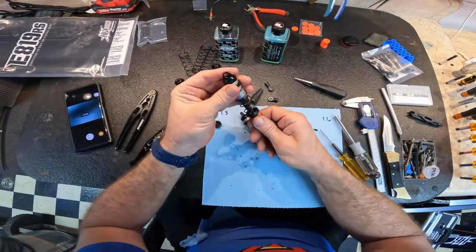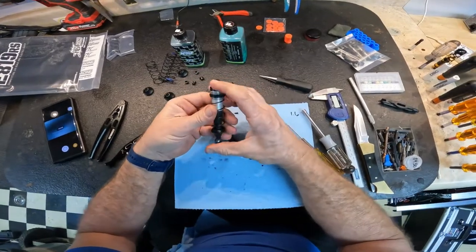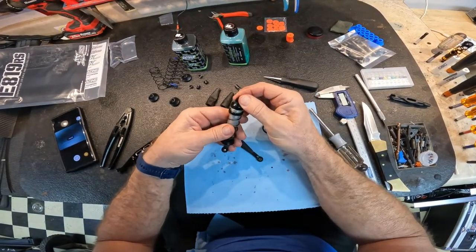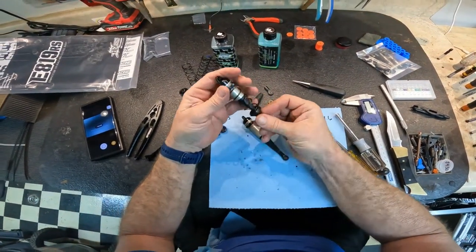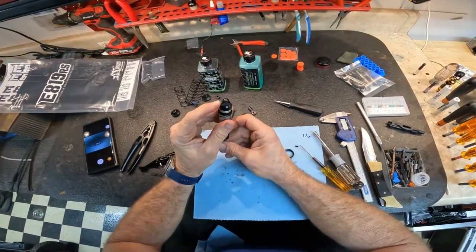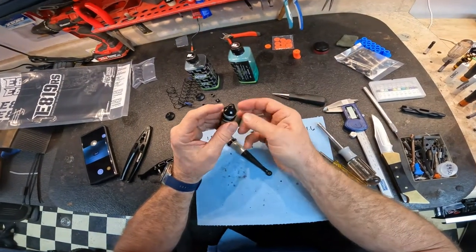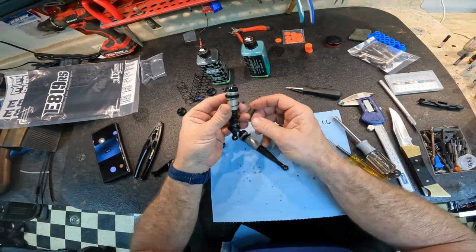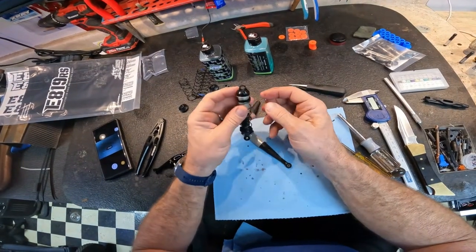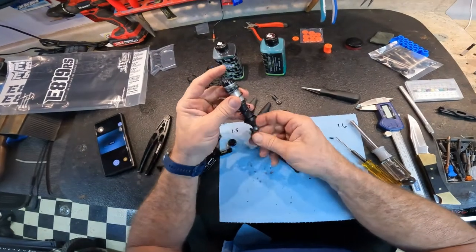Okay, so you just slide your spring up in there. Then the collar goes on. I guess you call it a collar, I'm not sure. That feels super smooth. I like to set mine up with the vent facing outward. If it leaks any out of the bleeder, it doesn't tend to leak down on the car. I have had times where I left it loose and made a mess. It's still going to make a mess, but that's just why I do it that way.